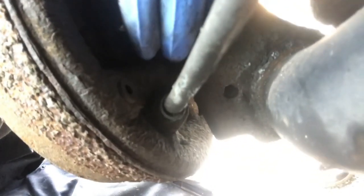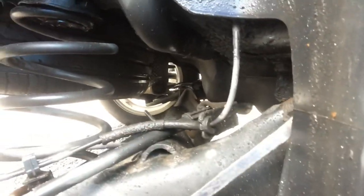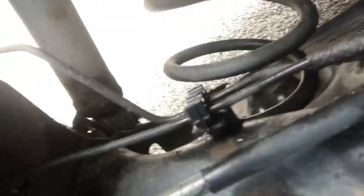We'll check these brake lines for any corrosion — which looks all fine. There's an ABS pickup just down there, all nicely securely clipped. Then we'll get the pry bar and give the rear axle a bit of a wiggle — same sort of setup as you see on most Fords. It's just an arm that goes straight across the bottom of the car. We'll give that a bit of a wiggle — there's no play in that, that's fine. Checking the bottom bush for the suspension joint and the damper — that's fine as well. All in all, pretty decent under here, apart from obviously that spring which needs addressing — which is a simple fix, the back one's normally dead easy.